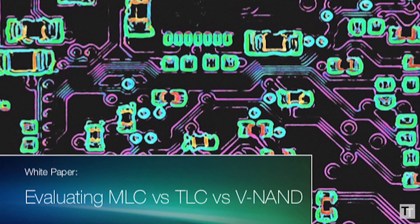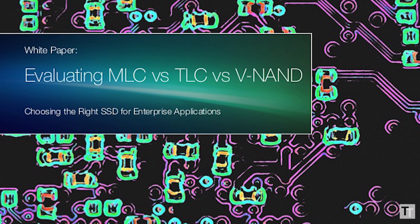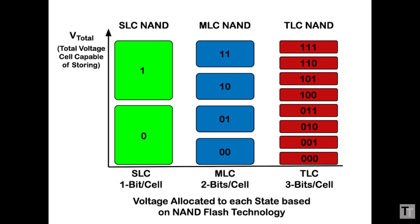Like the 950 Pro, the 960 Pro's NAND is also used in an MLC fashion — that is, only two bits of data are stored in each memory cell. That's as opposed to TLC NAND, which uses three bits. TLC allows for much greater data density but is much slower to write to, so various tricks are used to increase short-term write speed. With MLC, though, write performance is consistent.